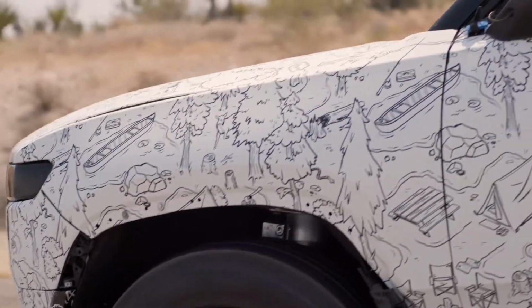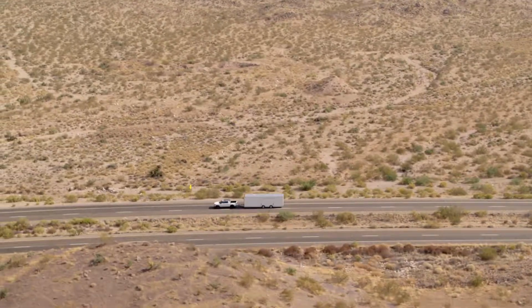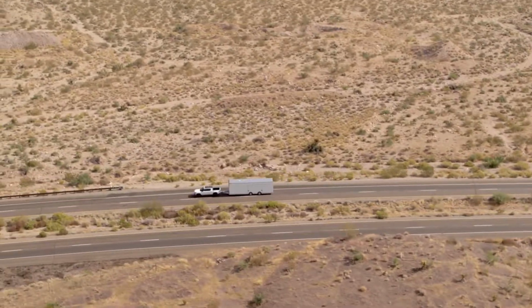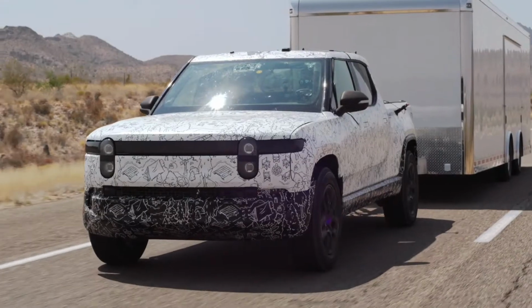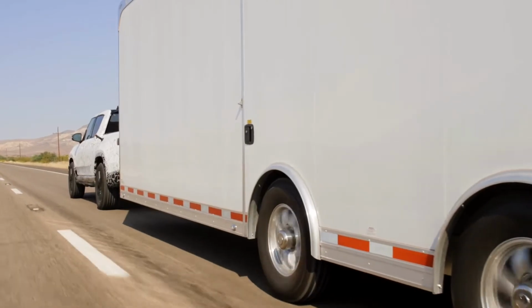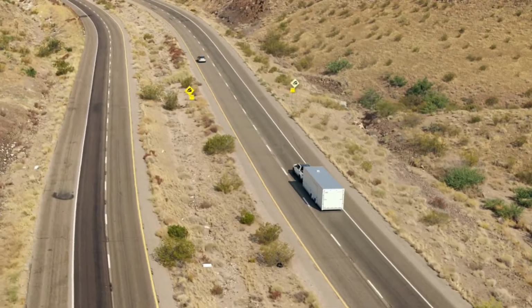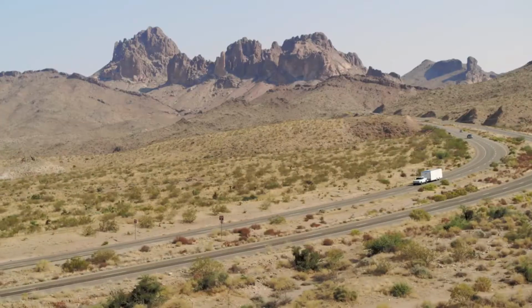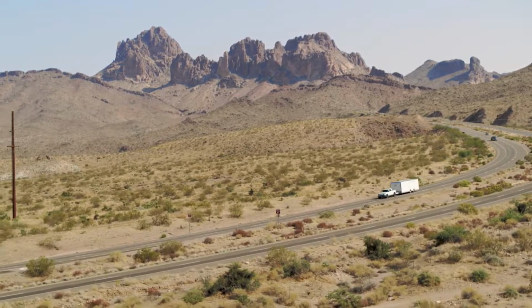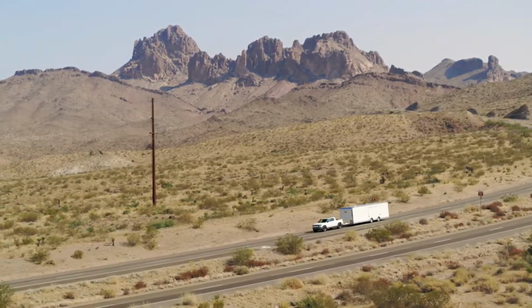We're doing the Davis Dam cycle, and this is where a lot of trucking companies come to prove out their towing capacity. What we're really looking for is to maintain cabin temperature and maintain the powertrain cooling as well. And what we're trying to get is a limitation in neither. Did it on Davis Dam with 11,000 pounds. It was pretty good to see that thermal validation happening. We were passing all the criteria, so it felt pretty great. All these 36 hours are definitely worth it.